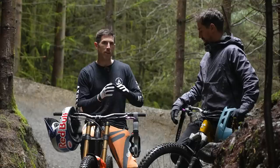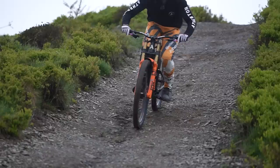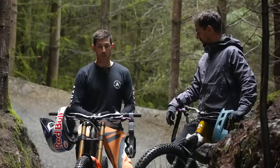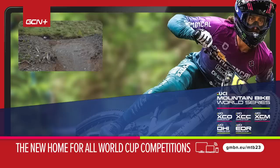You're riding a downhill bike, downhill tyres, big brakes — what sort of tyre pressure have you got? I run the tyre pressures quite soft. These Schwalbe tyres have a good strong sidewall, very supportive — you can get away with 24 to 26 PSI on pretty much every track. Ever run inserts? We run tubeless with the Stan's rims and sealant, and that's fine for me. I'm not an aggressive rider where I'm hammering through the rim or ripping them off, so I've found no need.